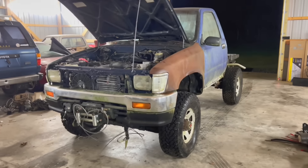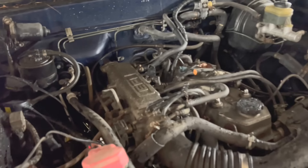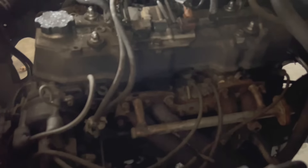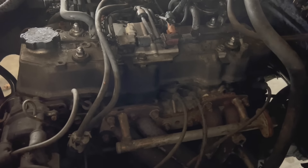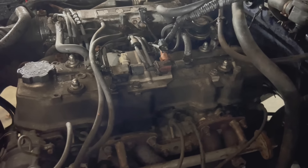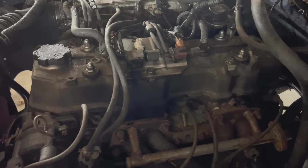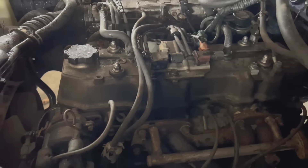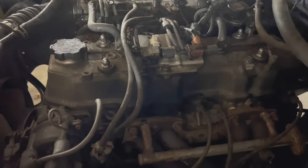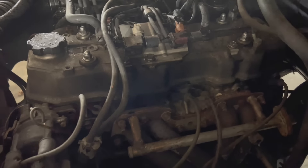We got her in the shop. First things first: going to do a new battery so I can stop jump-starting it, do a compression test, new plugs - I broke one of the plug wires pulling that off so I need new plug wires. I'll probably borescope the cylinders while I have the plugs out just to make sure everything's alright down there. It's running, but I don't think it's firing the injectors, because it only runs when I've got the gas can hooked up to the vacuum line. I had a 12-volt power supply driving the fuel pump directly and it still wouldn't run off the in-tank fuel - and that's fresh fuel I just bought yesterday.